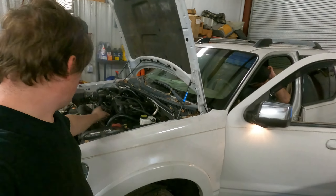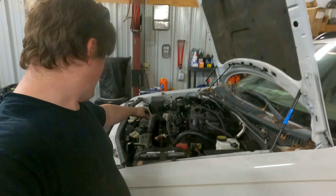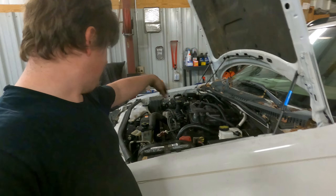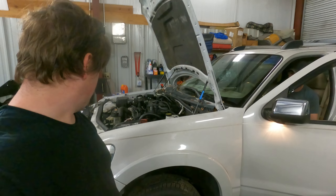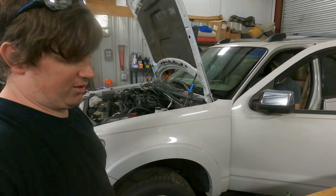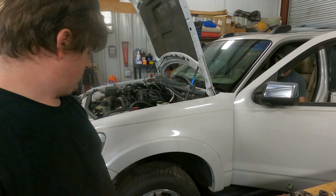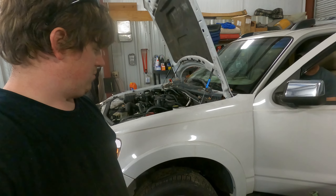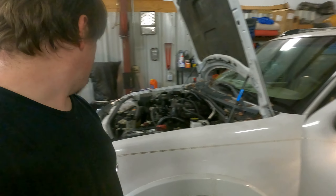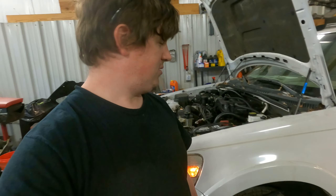I think we finally have our fully assembled water-coolant-looking stuff in the radiator — something that's going to make the motor cool. Fan, fan shroud, belt — all that good stuff hooked up. We'll have Jason bump the motor over to make sure we are not hydro-locking it, because we don't know this engine. All right, spin it. Well, we're not hydro-locked. We're going to let it run and see what happens. Got a little exhaust leak we've got to take care of — not a big deal.